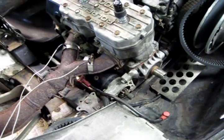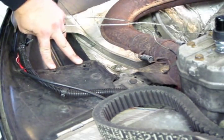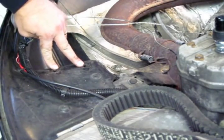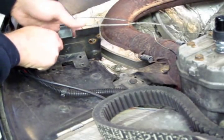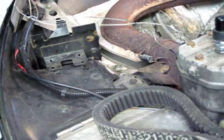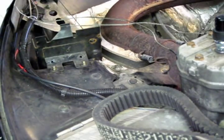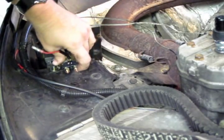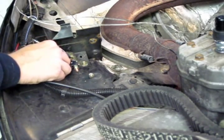Next thing we want to do is put the battery tray in. Now we're going to put the battery box in — the battery box has two mounting holes in the belly pan. The Polaris puts them in their knockout holes; you want to knock those out. Put your battery box down in here. This bracket serves two purposes: it's going to bolt the battery box fast, and it's also going to hold the solenoid. We're going to put one side in, but the other side is for our ground, so we're going to leave that off.